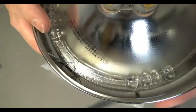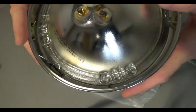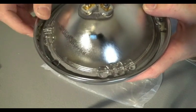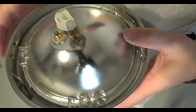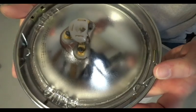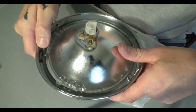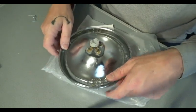I find it easier to put the clip on the inside edge — it holds just the same and it can be very difficult otherwise. I have actually broken a headlight putting them on that stepped area. Once you have two clips installed on opposing sides, you can install the rest, but you have to keep pressure on the opposing side so it doesn't slip and the clip won't move.